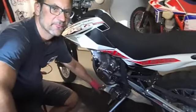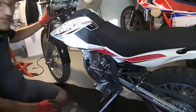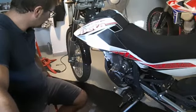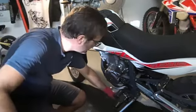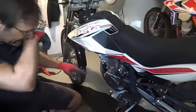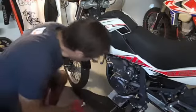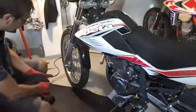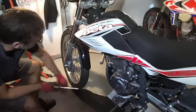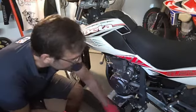So I lift the bike from this central booster, but the effect is this. The front wheel is touching the bottom. So we have to put it in a different way in order to let all the weight stay in this booster and in the rear wheel. Okay. Now we move forward the booster and there is a space here. So the front is lifted without touching the bike, so we have the weight all on our 3 points.